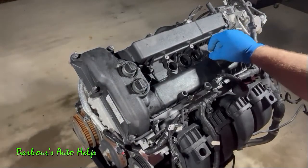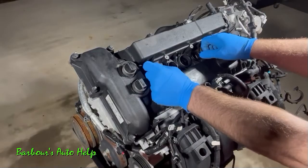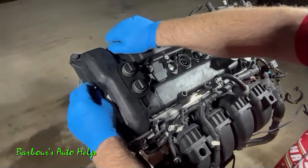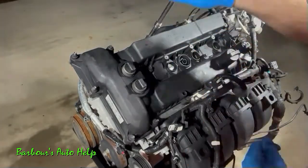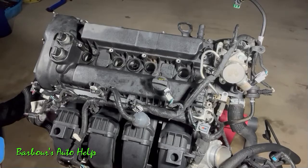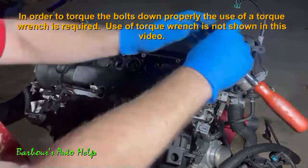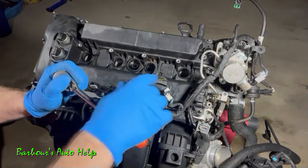Go ahead and start all of the bolts by hand — it's always best to start bolts by hand to avoid cross-threading. They should go in easily; if you feel a lot of resistance, back up and assess the situation. Get at least three or four turns out of each bolt before moving on. Once all bolts are run down, torque them in the same spiral outward pattern used for loosening. After torquing, go back through and double-check yourself, going all the way around.